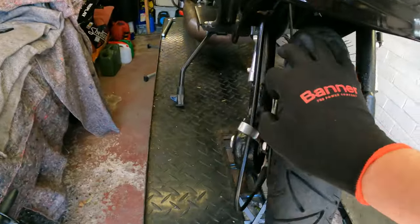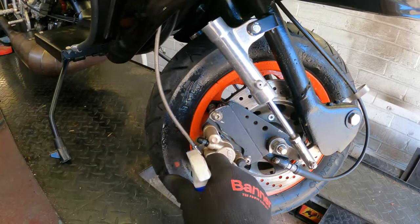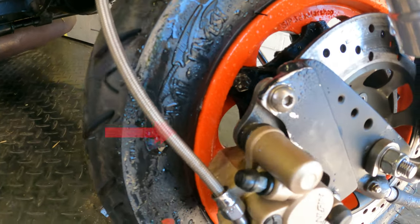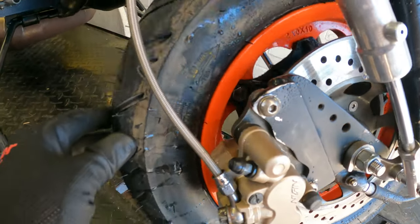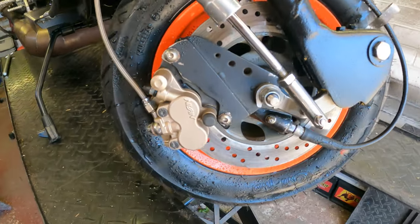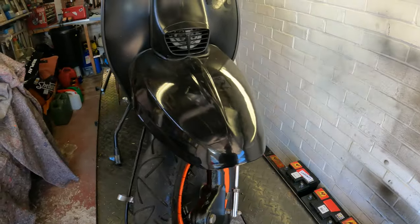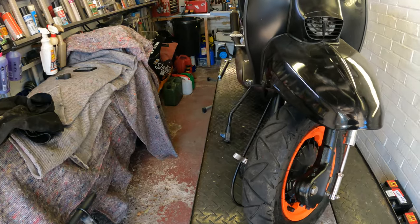I can't see nothing that side. So we've got a slight issue — it's not a puncture, it's not seating properly there on the rim. So what we're going to do is deflate the tire and put some gunk inside it, and hopefully that will seal as we ride it and we won't have an issue with the tire slowly going down.